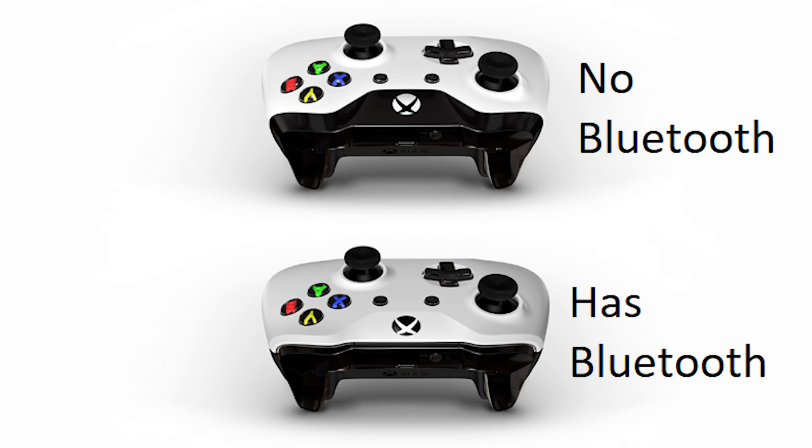Let's get started with the confusing part and get it over and done with. Microsoft released multiple versions of the Xbox One console, and some Xbox One controllers may or may not work with this method because they don't all support Bluetooth technology. The easy way to find out is to look at the Xbox faceplate where the Xbox button is at the top — if the faceplate matches the surrounding plastic around the Xbox logo, you're good to go. As you can see in the picture, the top example has a different type of coating around the Xbox logo button, which means it does not support Bluetooth, whereas the bottom picture has an all-around similar faceplate, so it does have Bluetooth capability.